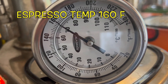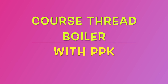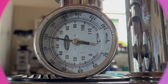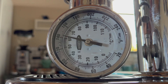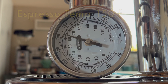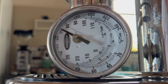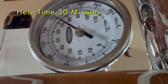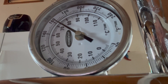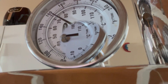Machine six has a stainless steel element — all the others had brass — plus a newer boiler with coarse thread and one of those pressure profiles. Heats up a little quicker: 6 minutes. First pull: 150°F, pretty good compared to many others. At 30 minutes: 164°F, right in the 160–165 range. We don't know yet, but maybe the stainless steel keeps it a little warmer.